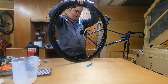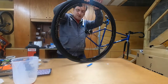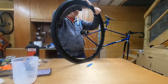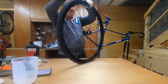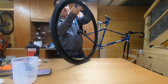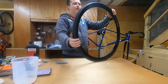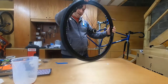Make sure the bead is off the rim at the bottom. If you're in the clinch, you want to get it into the center of the rim or you'll have no chance to get it over the top of the rim. I'm going to push it into the center of the rim — the bead is off the tire — that'll give just a little bit extra that you need to force it over. Nearly there. That went very well. Just have to go around a few times just to get it where it should go.